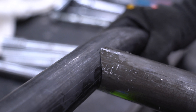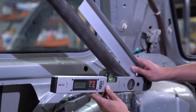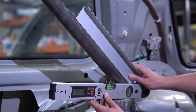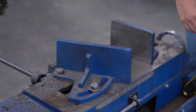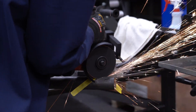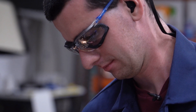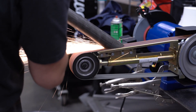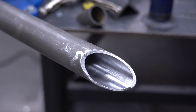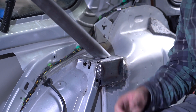Our math checks out and the fitment is looking good. Now we move back into the car and figure out how long and what angle we need to cut the other end of our backstays to sit flush on the base plates. Cutting angles can be difficult sometimes because you hit limitations of the tool you're using — we need to cut a 34-degree angle in the end of a tube but there's no way to secure it in the tool's jaws. Because of that we opted to use a four-inch cutoff wheel and then grind for final fit.